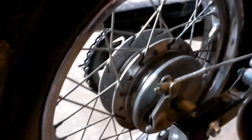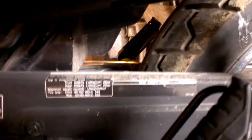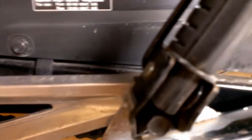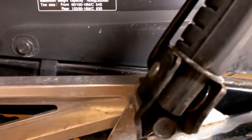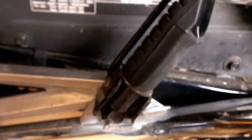Once we check the chain from up under here, at about the midway point between the sprockets — about right in here — that's where we wanted to check the looseness of the chain. So we adjusted the back sprocket out to where it was within the tolerance listed in the manufacturer's manual.